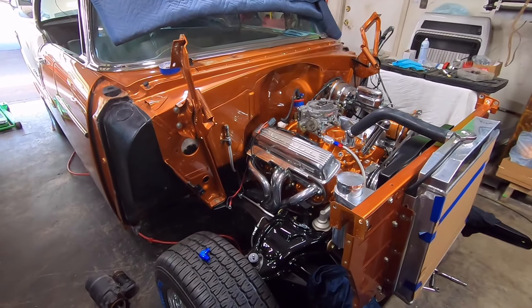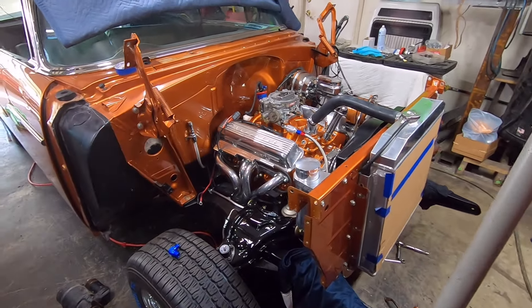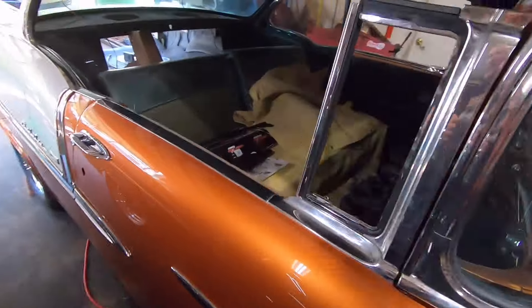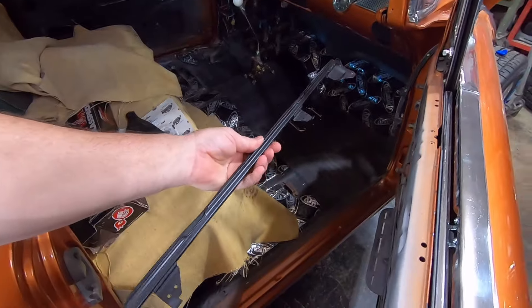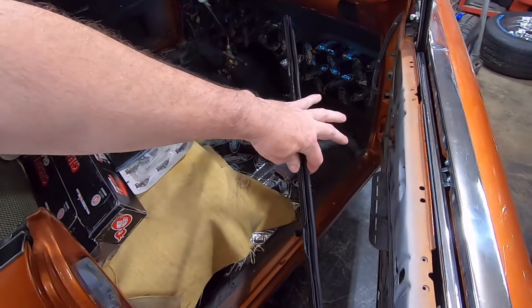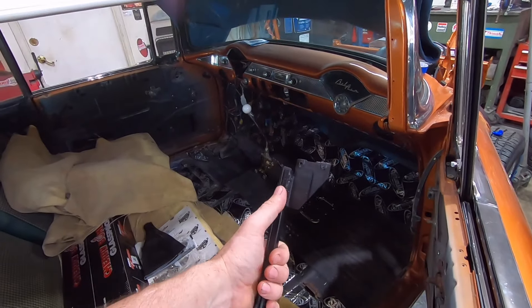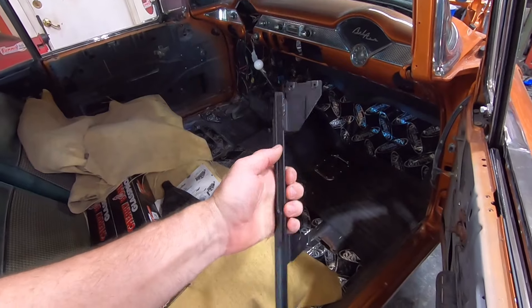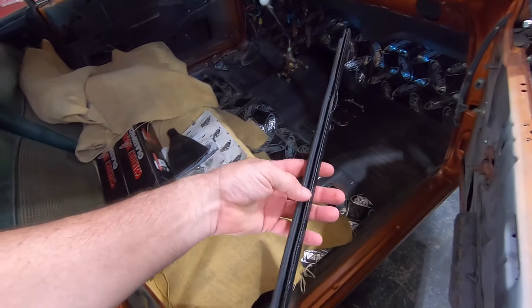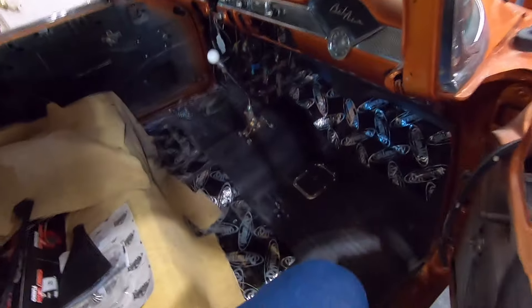That's pretty much where I'm at with Steve's car — just these little finalizing details that always end up biting me. When you've got something looking this awesome you can't start half-assing it. Almost forgot — I did find in my shed the correct right-hand window track piece for the door, because it currently has a left-hand piece which is incorrect. I blasted and painted it, and before that I welded it back together — it had been brazed in the wrong spot, so I put mig welds in between. Then I put the glass setting channel back in. I need to swap that out.